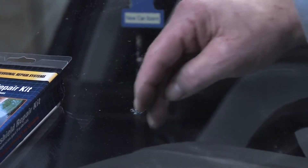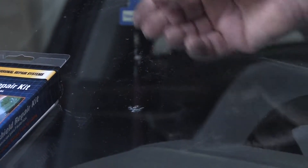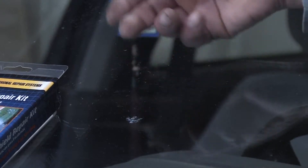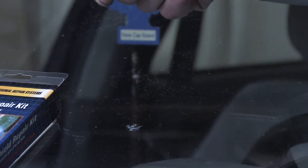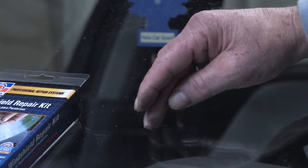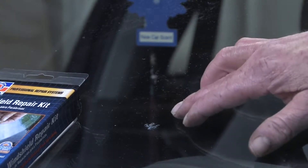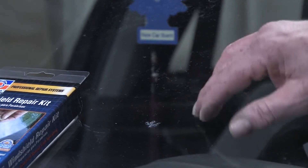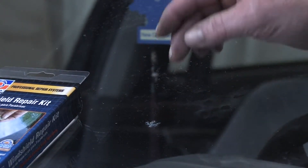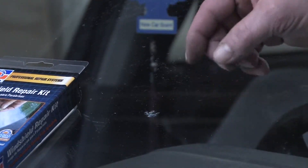It's going to set up on the windshield on the outside with some type of suctioning or stick-on device that will hold an applicator, allowing you to pull a vacuum on it and then simultaneously apply pressure to fill that chipped area with a glue or bonding agent. That procedure may need to be redone several times in order to purge all the air out and fill all those cracks and crevices with the sealant.